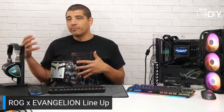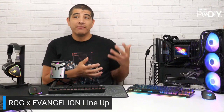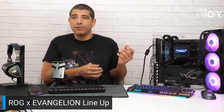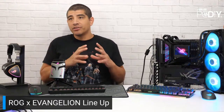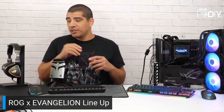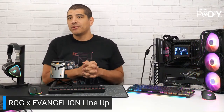When you use an analog-based headset, you're relying on the amp and the DAC that essentially is built into whatever device you're connecting it to. And that can be quite variable, right? There can be an okay DAC or amp maybe on your laptop, a much better one on your motherboard, an okay one on the Switch, and maybe a really poor one on your phone. It can really vary. But having it natively built in allows us to not only ensure a consistent experience across all those devices, but we can also more carefully tune what are called the drivers within the actual headphone themselves to be matched to the actual DAC and amp that we have as part of the headphone. So it allows for a really seamless, great experience.